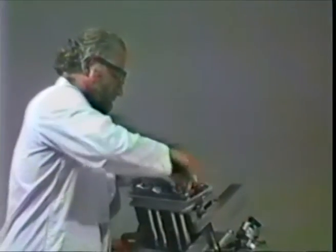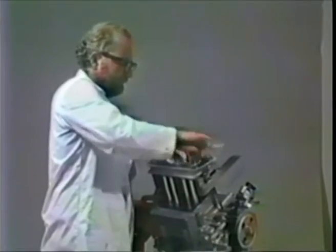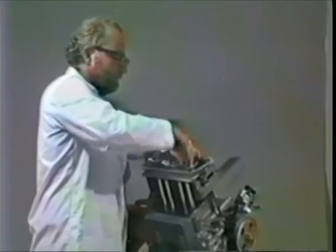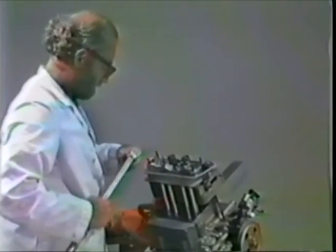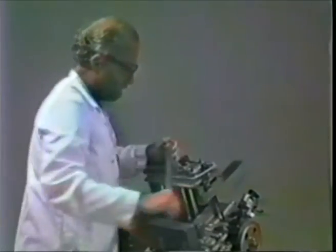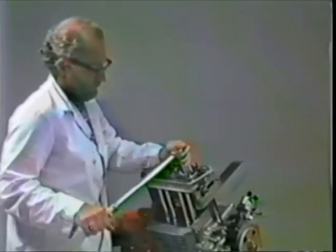Torque them down to where they're snug. Get out your torque wrench that you just used. Remember, you torqued the head to 25 foot-pounds, and the torque on these bolts is 29 foot-pounds. So it's not far away from the 25. And get out your torque wrench, set the torque to 29. You don't really have to creep up on these, but you can if you want to. 1, 2, 3, helps to check them. At this point, you can flop the engine over to the other side.